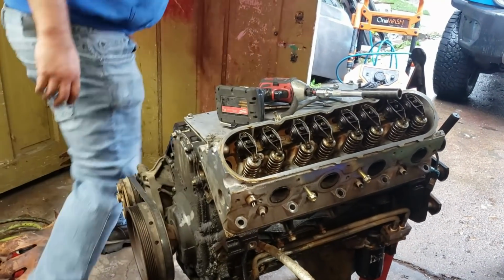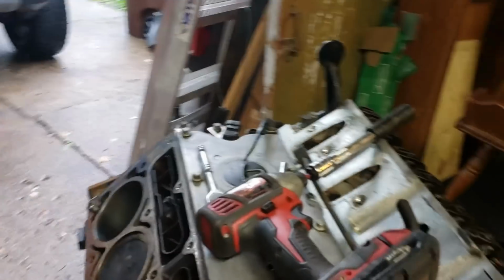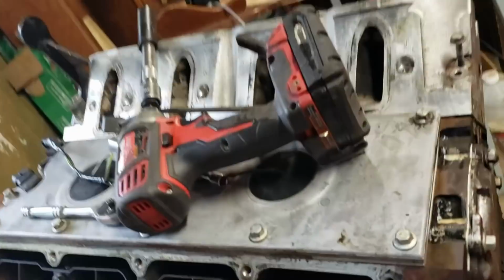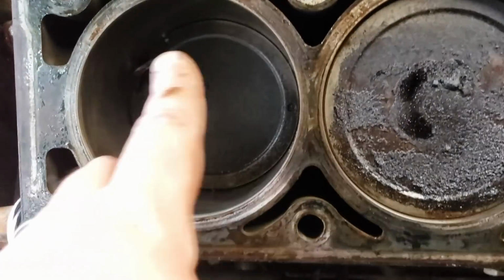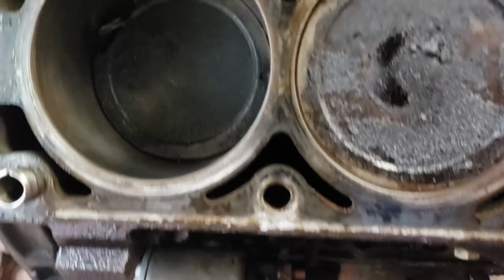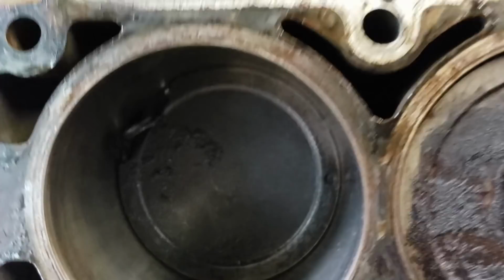Okay, come here, please. There. Number 8 had a busted manifold stud, and it looks like that led to a lean condition that caused that ring of butt ends.